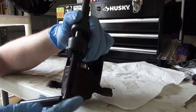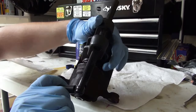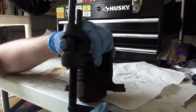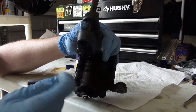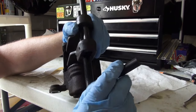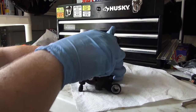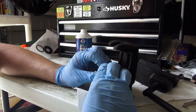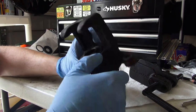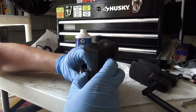I think I just felt it going through the seal finally. Now once you begin to force it back down most of the way, you are going to notice the boot is going to want to begin to seat already. Push that piston in until you feel that you have enough spacing for the boot to seat down, then remove your tool and begin to pop the boot in. You don't want to use tools for this unless you have plastic cell phone screen remover tools that are not going to poke through, because if you tear this boot you pretty much just negated everything you did.